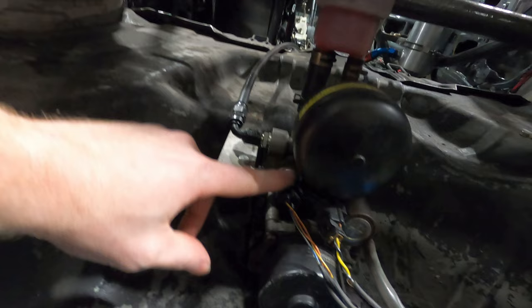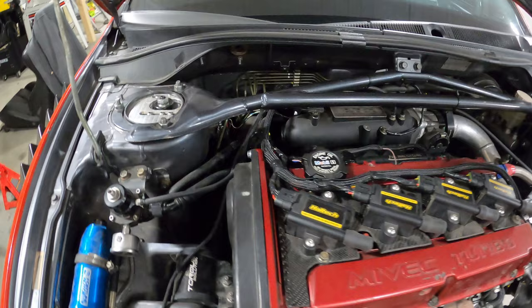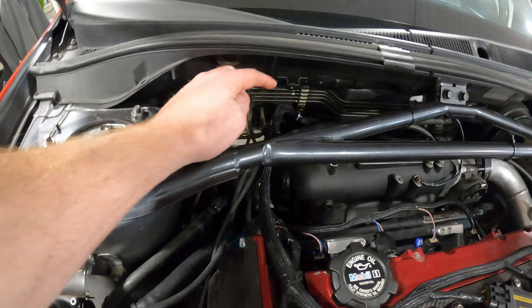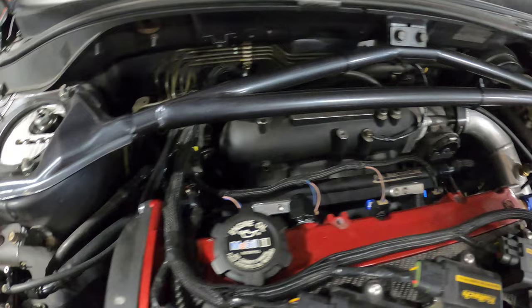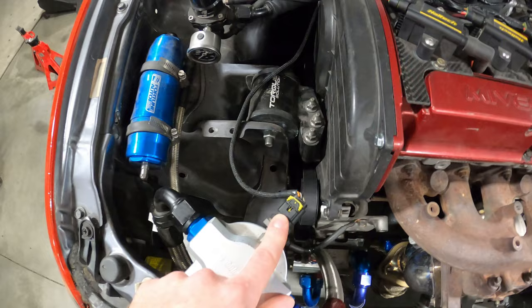In the trunk we have the ACD pump mounted, along with the pressure sensor switch. We actually had a problem with a bad sensor that had all three ACD lights on, and once we changed that out, the ACD system started working again. The wiring comes through the stock location behind the motor and splits into two areas. On the left it goes to the alternator, knock sensor, crank sensor, fuel temp and pressure, coils, and injectors — these have a slightly different style connector with little ears on the side that come out a bit easier.